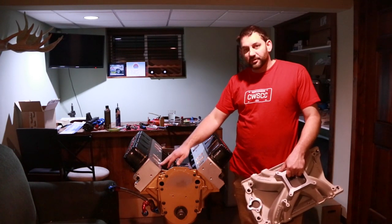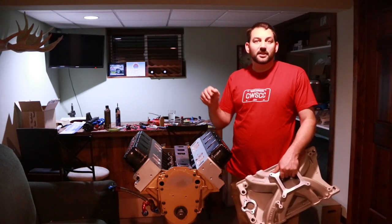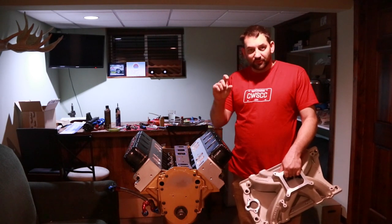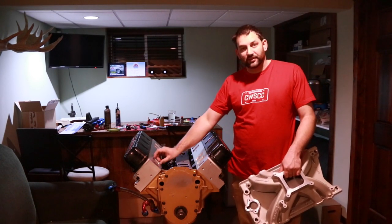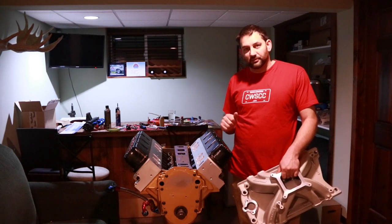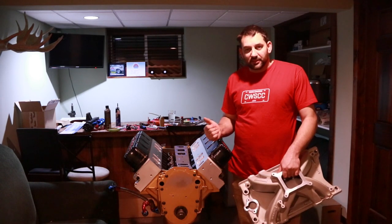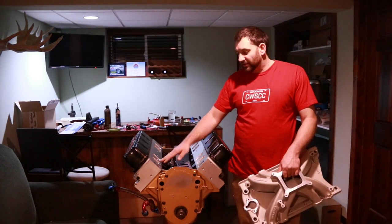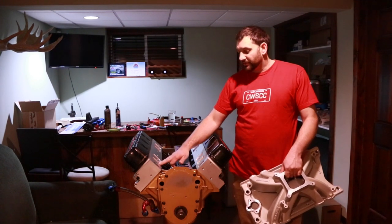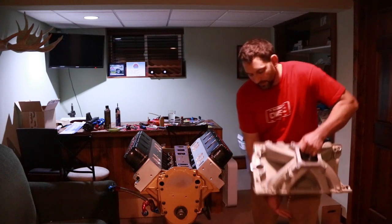You don't really have to on the floor, and having a little ledge there, as long as it's a step into the head, as in the intake manifold is smaller still than the cylinder head opening, that can actually act as an anti-reversion dam. And it's not going to affect performance a whole lot because it's actually a fairly slow part of the port as far as airspeed goes. So we are definitely more worried about the sides and the roof getting them matched up.